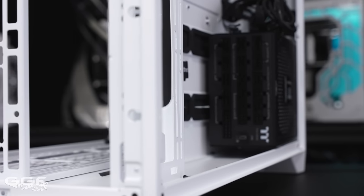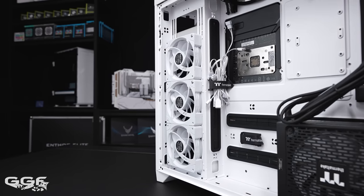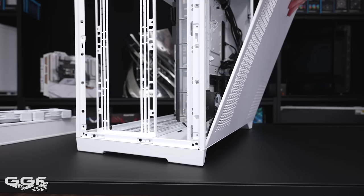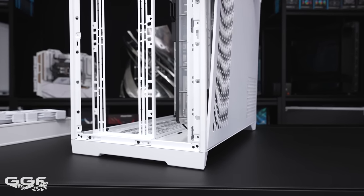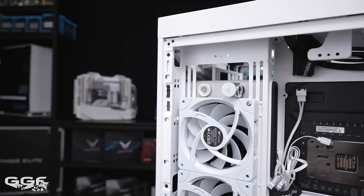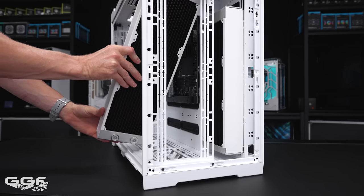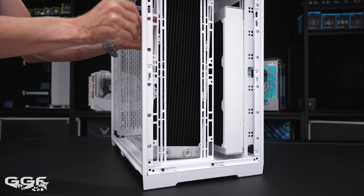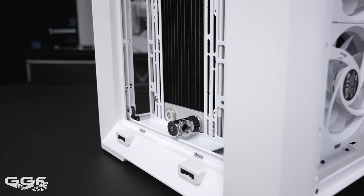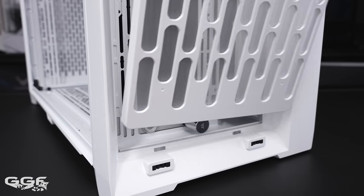Behind the side bracket is roughly 42mm of clearance here for either fans or something like a DDC pump sticking through from an EK-FLT res combo. Take note that a D5 will not fit in this back part, DDC only. 360 radiators can also be flipped on this bracket if you wish to have rad ports shooting in the back chamber for a clean tubeless look. This also works for the front and left side radiator brackets for even 420 radiators, as they can be flipped with ports facing out for some crazy clean soft tubing runs. No issues here with the bracket cutout failing on rad ports.